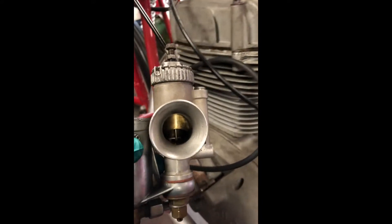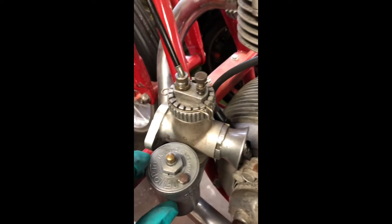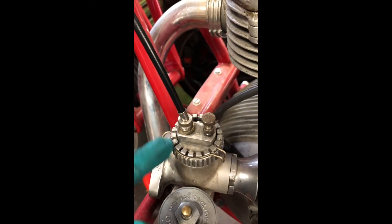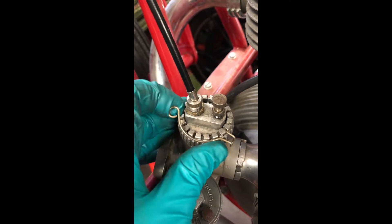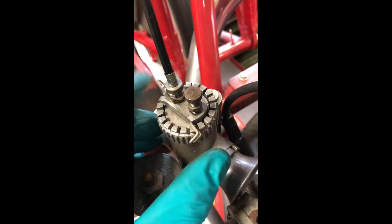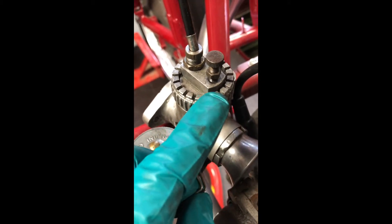I unbolted it from the side of the bike. You need to remove it from the cable, and you do this through this clip — there's a part that holds the top on. If you pull the top of that out and lift it up, you then pull this part out. There's a pin which secures through that castellation, and there's a little hole in the top here, and that pin stops the whole part rotating.